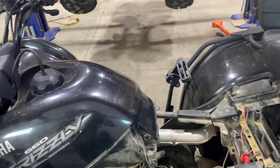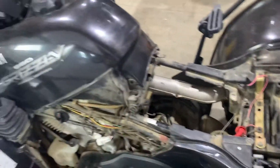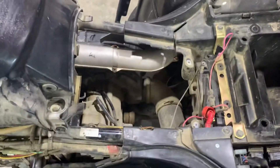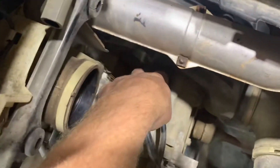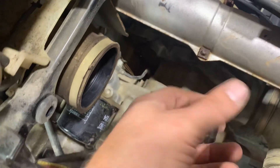The simplest way to fix this issue is to pull the air box out. It's very simple — there's only a couple of screws on the top of the air box, and then you'll be able to just pull it right out. There's a gear positioning sensor in here with two 10 millimeter bolts. Take that out and this is the gear positioning sensor.